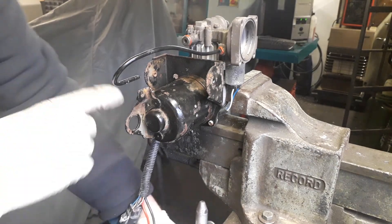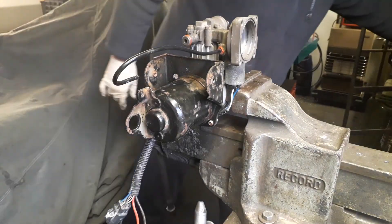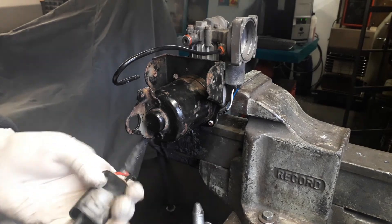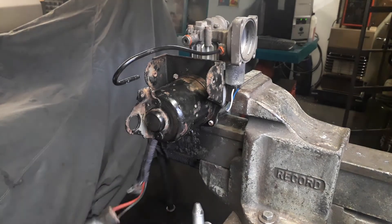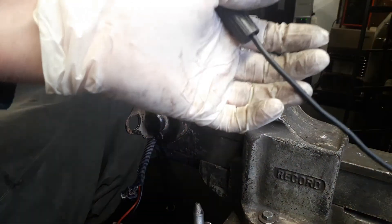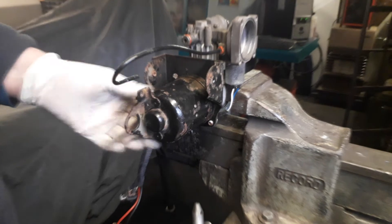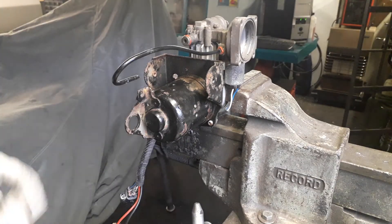If you have the facility in your workshop, you can actually run these on the bench. These are the actual power wires — red and black. If you've got some heavy duty leads and a 12-volt battery on the bench, you can connect that up — black to black, red to red, just double-check you've got them the right way around. As you can see, I've not got the exhaust valve fitted and we haven't got the air dryer on so it's noisier than normal, but you can see the motor spins over fine — just for demonstration purposes.